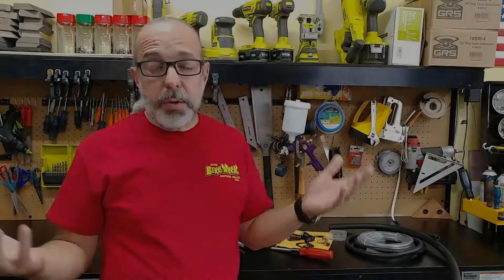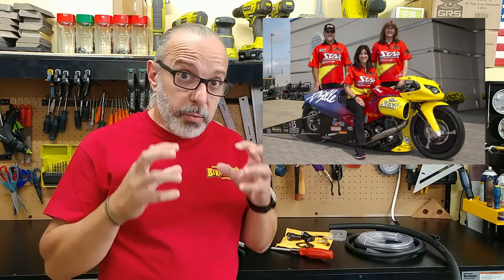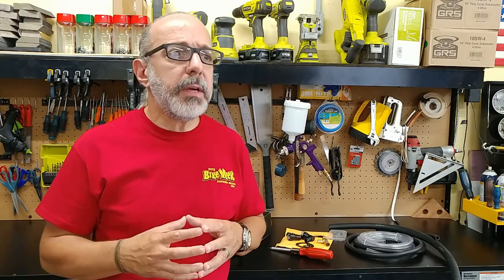I have an extensive background in building race engines for cars, motorcycles, and even boats. In the late 80s, early 90s, I experimented a lot with positive crankcase ventilation on all kinds of different vehicles. That was my go-to thing to make easy, free power. My friend George, who I started racing with, has multiple rules written in the NHRA rulebook to address the things that we were doing. We figured out on a dyno almost by accident that creating a vacuum in the crankcase would yield an extra 8 to 12 horsepower, depending on how much vacuum.